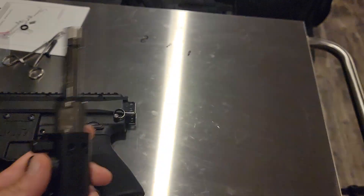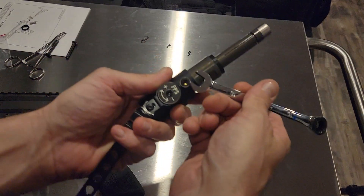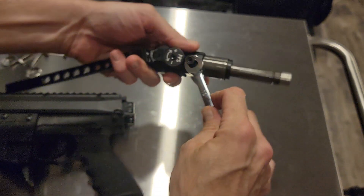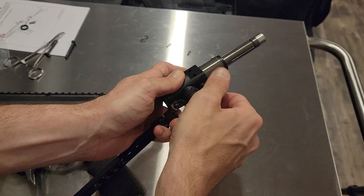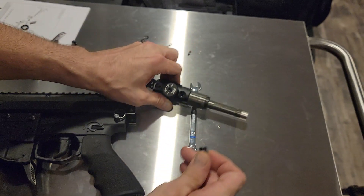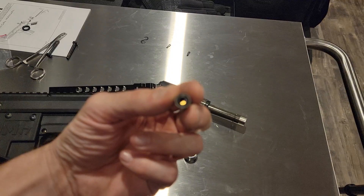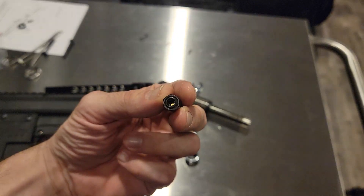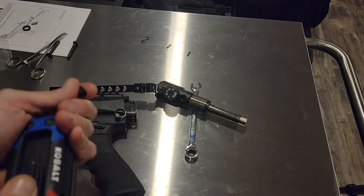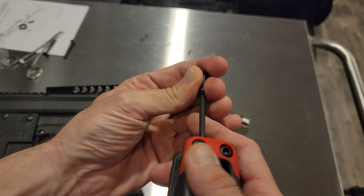Alright, that's done — really difficult, right? Okay, so 10 millimeter. This is what's called the set screw mod. There is an o-ring under there you're supposed to be careful with, so just ease it out. I'm using a four millimeter hex key, Allen key, whatever you call it.